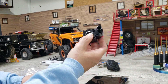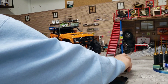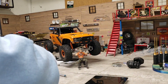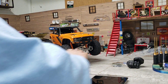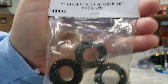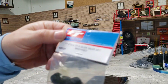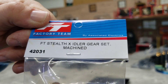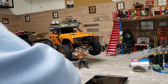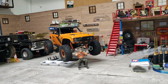You use the remainder of the items like your shafts and bearings from the original into this case. This is brand new - came off a brand new RTR takeoff. Here are your part numbers for the factory team stuff: the drive gear set is part number 42032, comes with all three gears. The idler gear set is part number 42031. That should be all I need - I can't see breaking these unless you drive like you're on crack, which I don't.